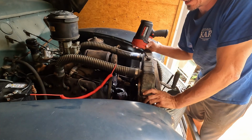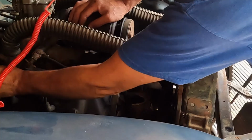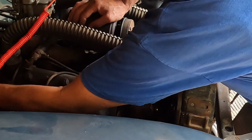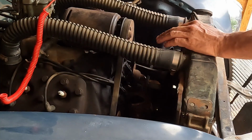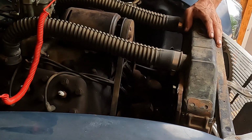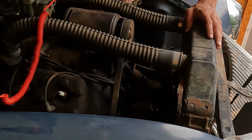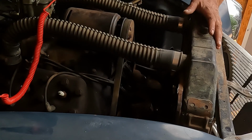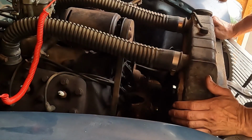That's just not smart. Distributor caps themselves are made out of a fibrous plastic, and what happens to them over time, from what I read, because I can't get them apart, is that the fiber starts to swell up, so pretty much if they're stuck, you're gonna break them trying to get the distributor caps off. So for me to do this, I'm gonna have to attempt it without taking the caps off and do everything through the hole for the coil, which I should be able to achieve.